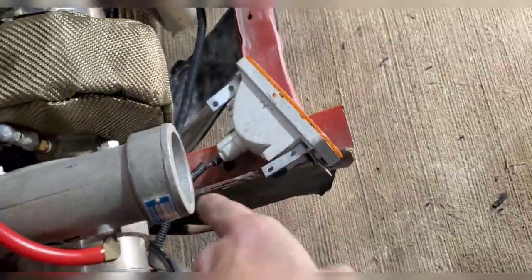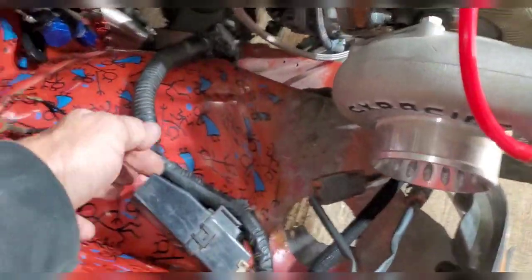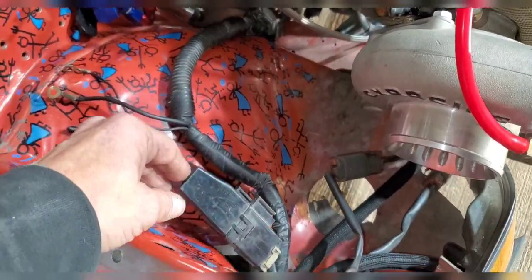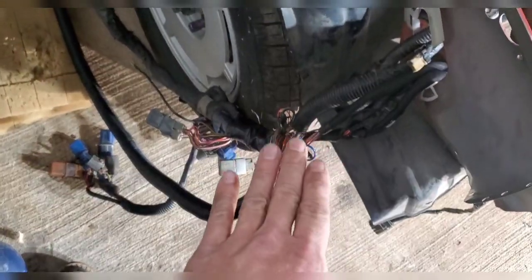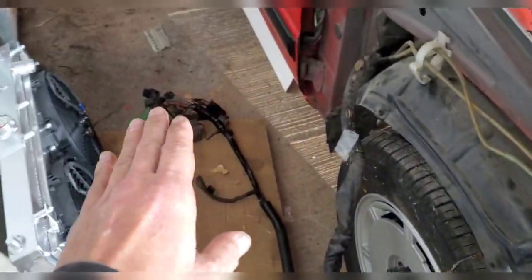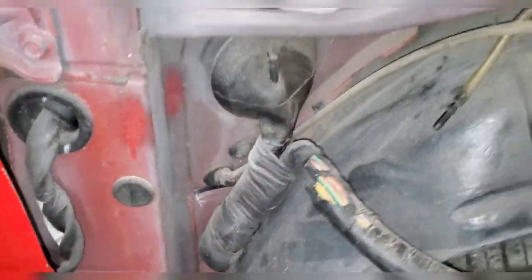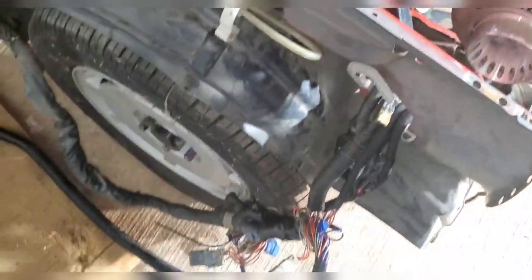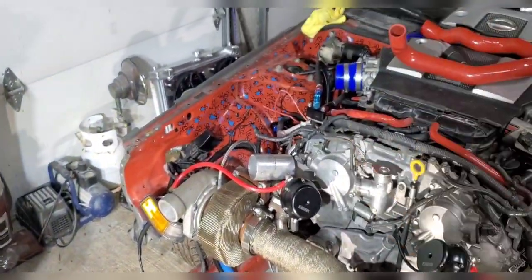This side I just got done making its harness — so this would be the headlight, marker lights plugged in, parking lights plugged in, blinkers plugged in. I'm gonna have to mount this somewhere right here; might have to go out to my parts car and grab the bracket because I don't know where it went, then remount that. Put up a couple ground wires. This is the wiring that isn't going to be used — quite a substantial bit — but yeah, we're basically all done with the wiring harness now. I can just button it up, get the fender put back on, and we're good.